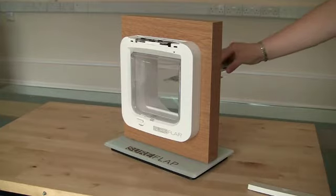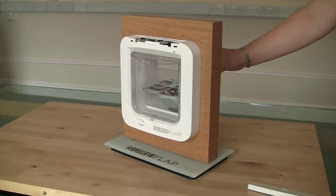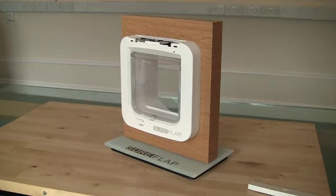Put the square part of the range tester into the middle of the tunnel until it touches the door. The light will stop flashing once the microchip has been stored to memory. Now remove the range tester from the tunnel and the motorized catch will close.